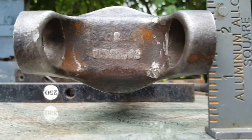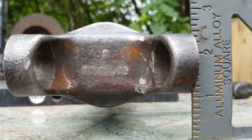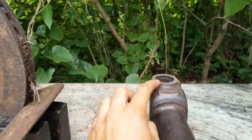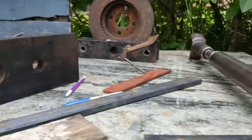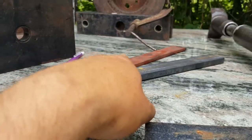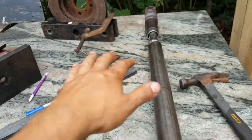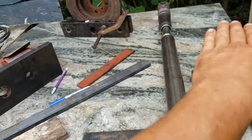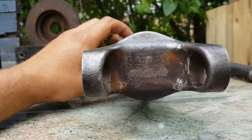That's pretty good - spot-on, perfect. Over there I just sanded off the head a little bit because it was kind of rough and there was dirt. I sanded it off with a solid piece of steel backing the sandpaper. If you use a spongy type it's obviously just gonna conform to the curved shape - you want to plane it smooth and flat, not curved.